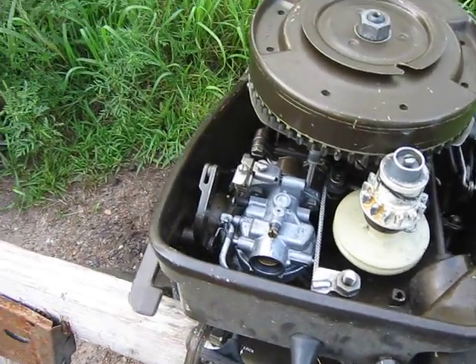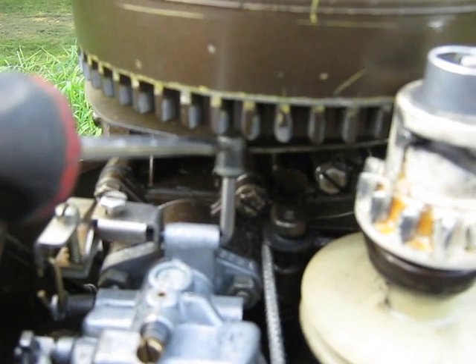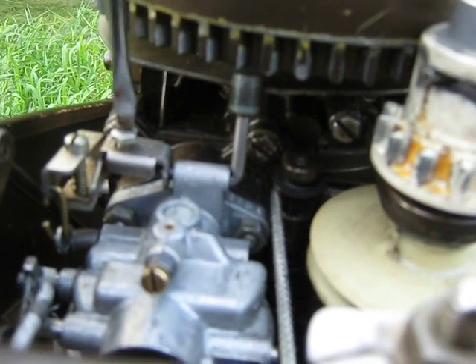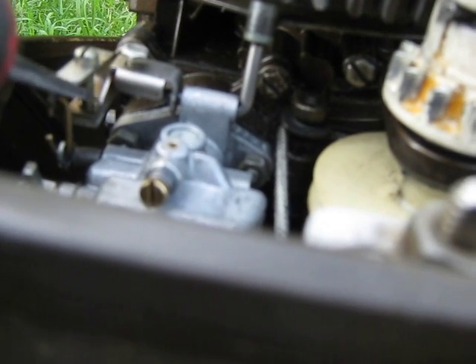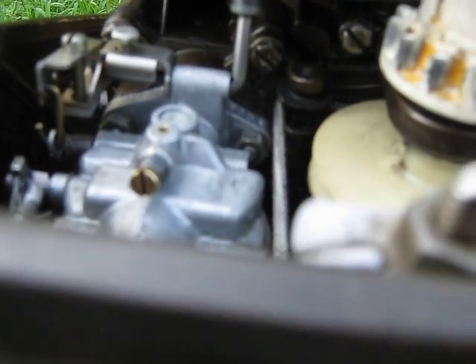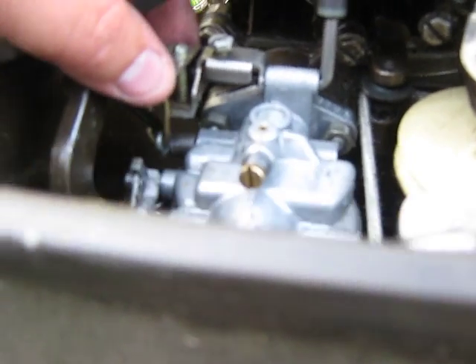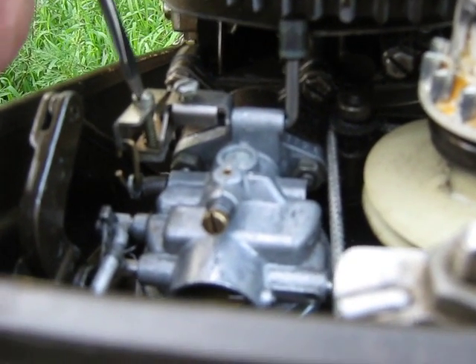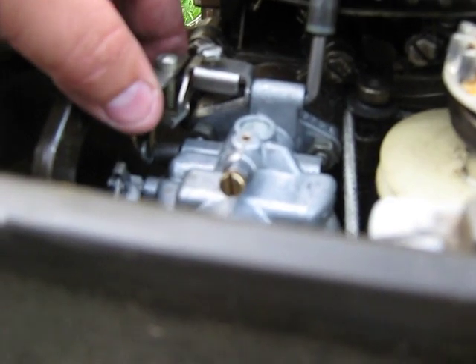Nice and happy. I will turn it off. How I adjust the lash is with the roller lined up with the line on the mag plate. You'll loosen this screw up, and loosen up this one too to where it's at its widest opening. When you loosen this one up — like so — I like to tighten that one back up a bit. Then I will tighten the lash screw here until all the lash has gone out of the throttle.